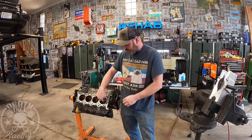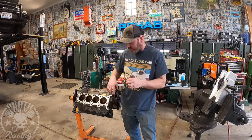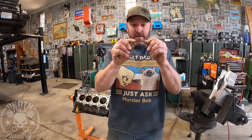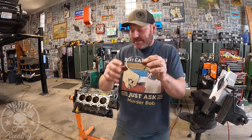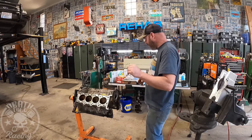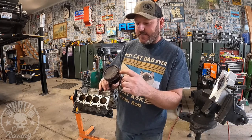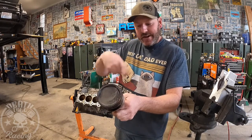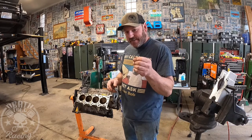So you have your ring and you have your gap. On a used engine, at the bottom of the cylinder it's closer to original size, and up top it's slightly larger. What happened is the ring bottomed out from heat — you're boosting the car, adding extra heat. The ring got hot, got longer, bottomed out, had nowhere to go, creating extra pressure on the cylinder wall acting as a brake. Then it split the piston right at that second ring, the bottom of the piston cocked in the cylinder, and everything started wobbling and smashing.